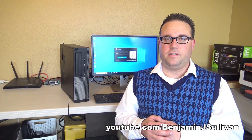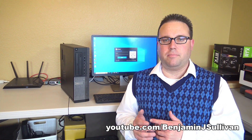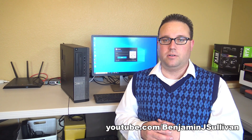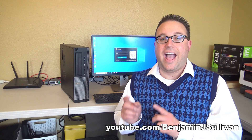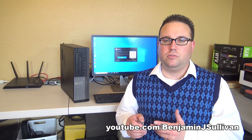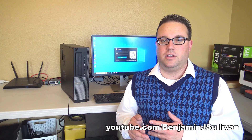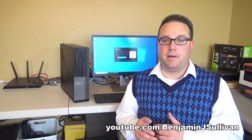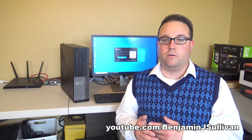You're probably thinking: if my computer has onboard video, then I don't need a physical video card. Well, you don't have to have one if your motherboard has onboard video. However, onboard video cards are generally not as powerful as physical video cards. If you use your computer for basic tasks like web browsing, word processing, or watching YouTube videos, onboard video is just fine. But if you're doing tasks that require a lot of video power — like gaming, 3D modeling, or video editing — you will get much better performance with a physical video card.